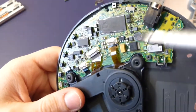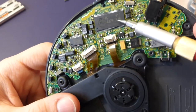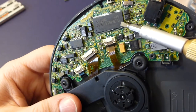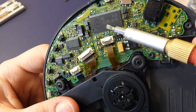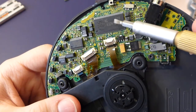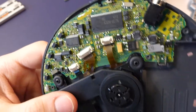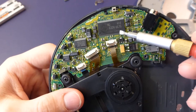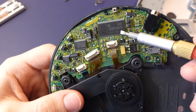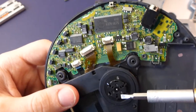We've got some chips — they all seem to be going this way. This is a Samsung chip; I'll guess straight off from the footprint and manufacturer that it's probably some form of SDRAM, which is most likely used by the encoder for the anti-skip feature. As I said, it spins the disc quickly, reads the data, encodes it into some digital format, stores it in this RAM, and plays it back. So you're never really listening to the CD directly — you're always listening to a lower-quality encode of it.